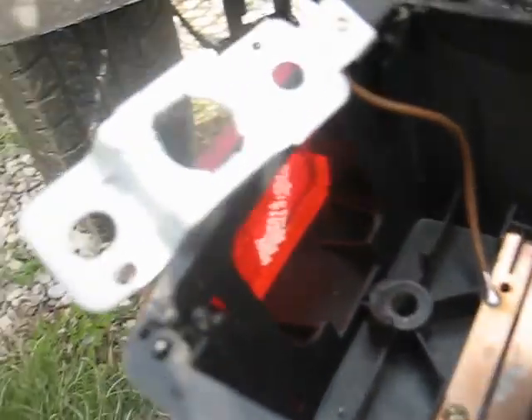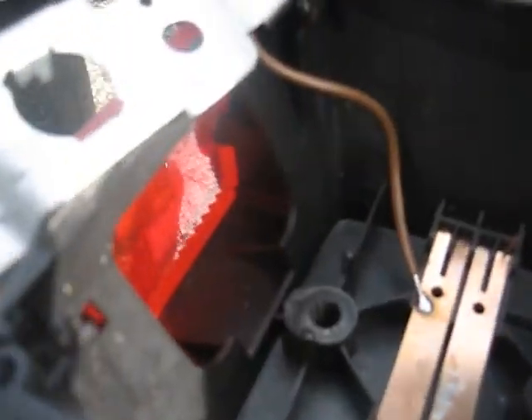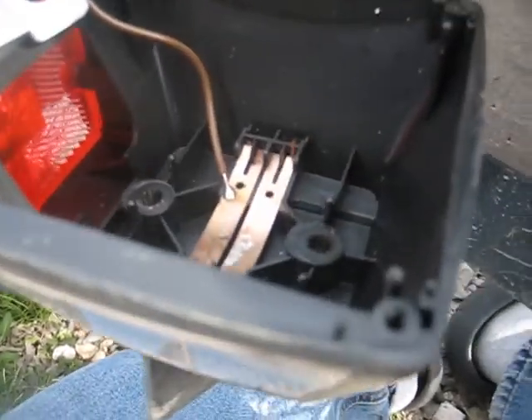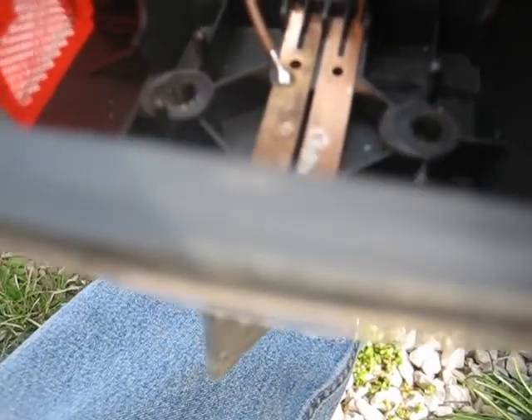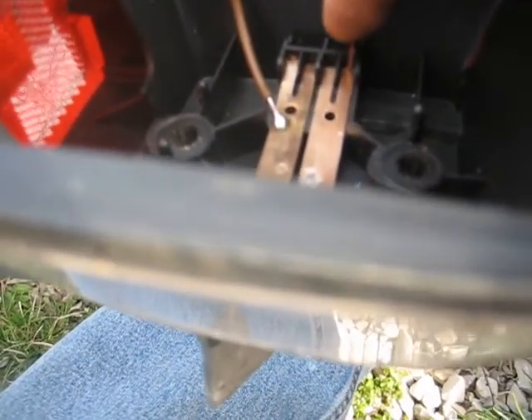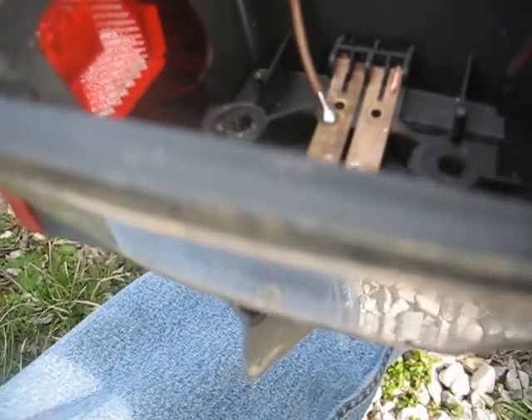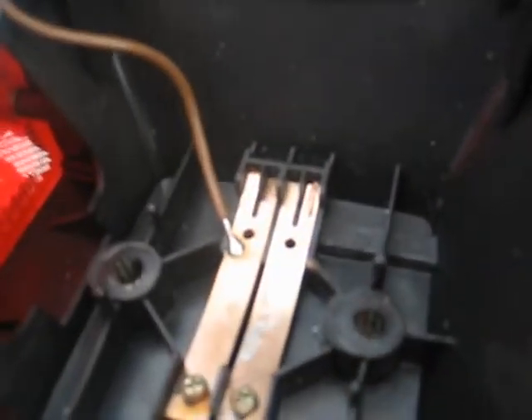Here's the light bracket held in by two brass-colored bolts with a grabber on the end that fits down inside the hole. I unscrewed it from the bottom, pulled the copper bracket out, then re-spun the wire and pushed it all the way through so all the wire is inside the housing instead of outside where it shorted out. Now I'm going to bend it over the bracket for added security so it won't go anywhere. I'll do the same to the other side, then put the bolts through and use the nuts on the back to tighten it down.